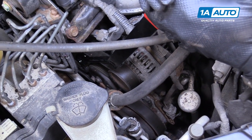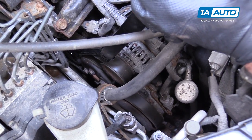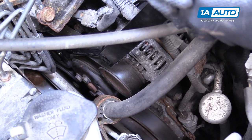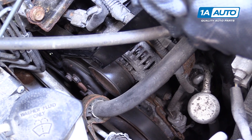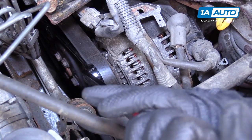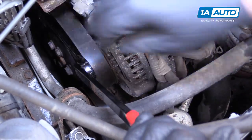It's like a shock. You can see — so you don't pull it really fast and hard because you'll break the tab off on the tensioner. You just sort of pull gently and slowly, and you'll feel it compress and the belt will get looser. You can see how the belt's getting loose, and then you can pull it off the pulley.